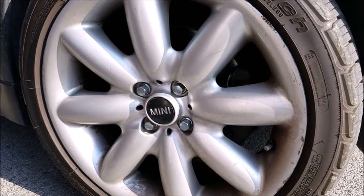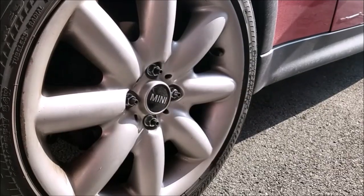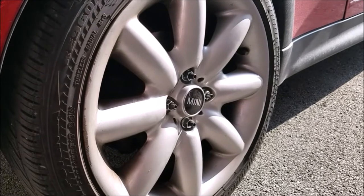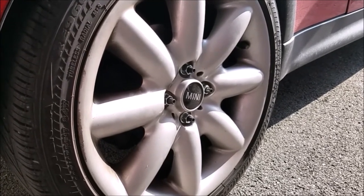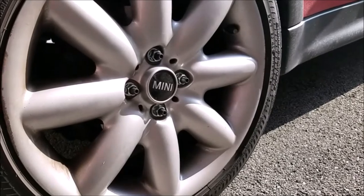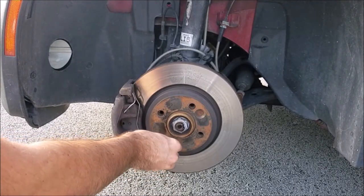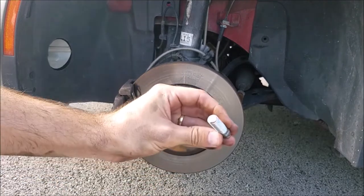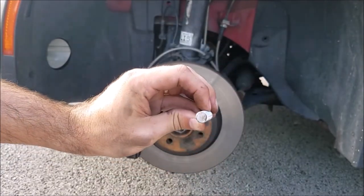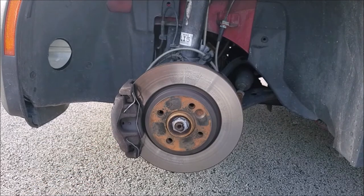I just wanted to give a quick before and after. This is what the wheel looks like with the normal wheel bolts — they kind of hide and disappear inside the wheel, just go unnoticed. And then back here with the studs, they don't jump out a lot, but if you notice them they might look a little weird to someone who doesn't understand what they are. So I'm not in love with them, but they're not as bad as I was expecting. You can see right here the broken wheel bolt — we'll pop the wheel spacer off and here's where the wheel bolt broke, nice and clean, just sheared right off. Didn't even know it snapped, just noticed it one day. So that's a little scary, and that's our main motivation for upgrading to studs — I don't want to deal with that anymore or worry about it.